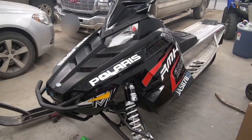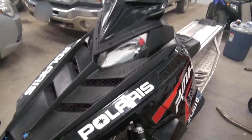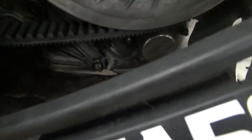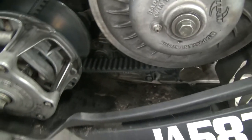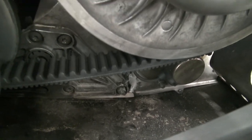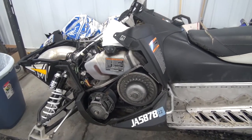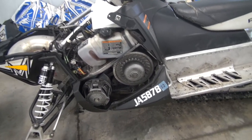Let's go ahead and put the side panels on. Plastics are on and should be good to go. I'll go ahead and talk to you guys here probably tomorrow. There was a crack in the tunnel - I decided to JB weld that to see if it would hold. It sure enough didn't. We're going to have to backtrack, take all this off, take my secondary clutch off, pull the track and go get that welded because I'm not going to send it knowing that there's a crack like that. I should have done it right in the first place - it's totally my fault.